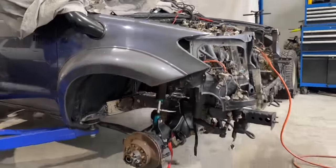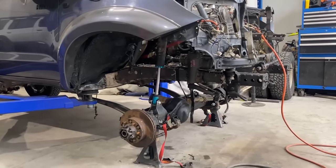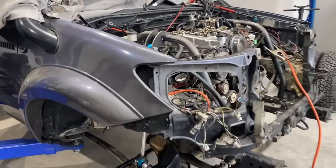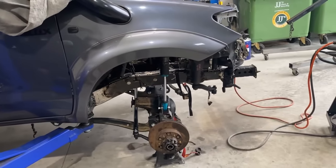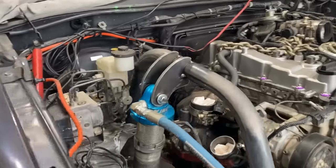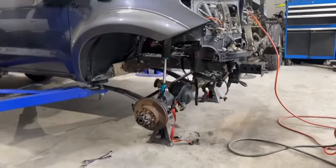So that will be about ride height there, stop there. So that's probably a tick over ride height, but everything looks pretty nice. Everything looks nice and straight. I'm pretty happy with all the angles. Just before, when we were on full bump, we had about an inch and a bit to spare, which is a little bit of safety. Keep going.